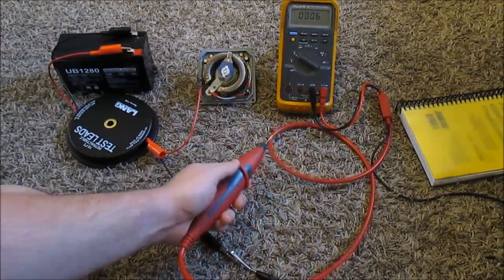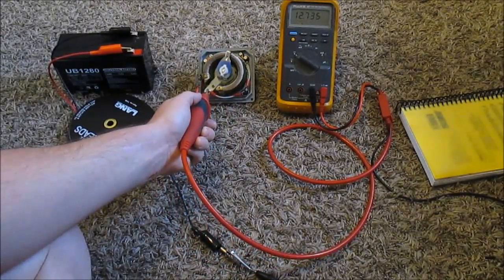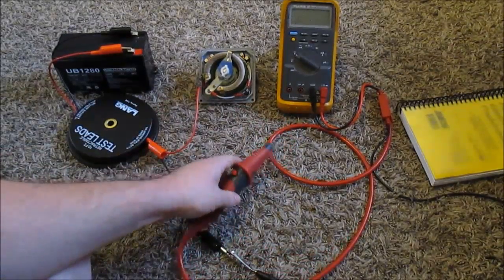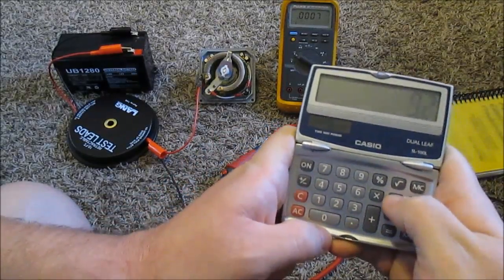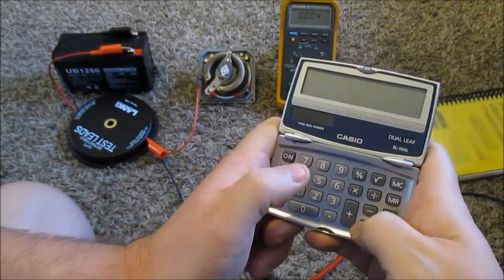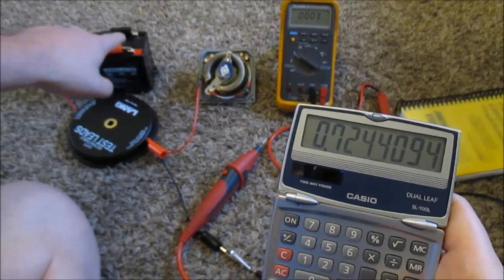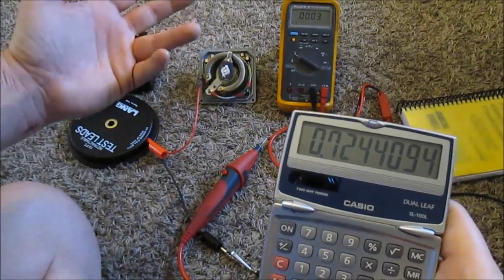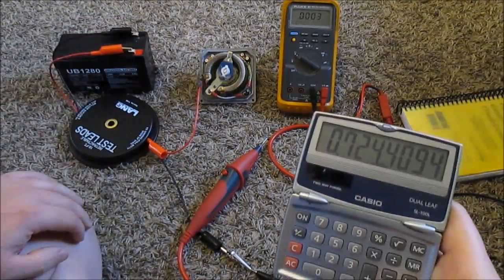Let me add a little more resistance - do one more test. Open circuit is telling me it's good - 12.7 - which it's not, because I have resistance in the wiring. I do my test and I've got 9.2 volts. So if I take a calculator: 9.2 volts divided by 12.7 - I've only got 72% of my available voltage at my load here, which tells me I have about 28% being eaten up in the wiring. That's way too much.